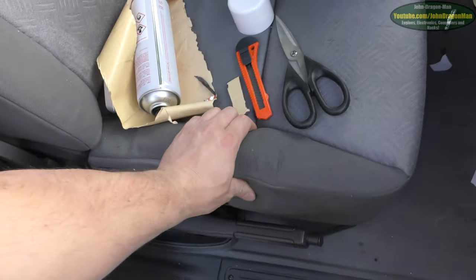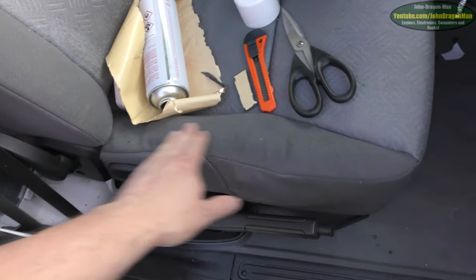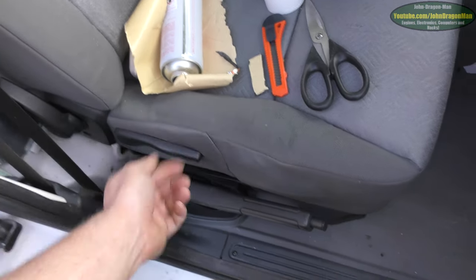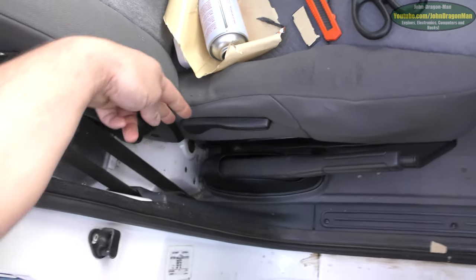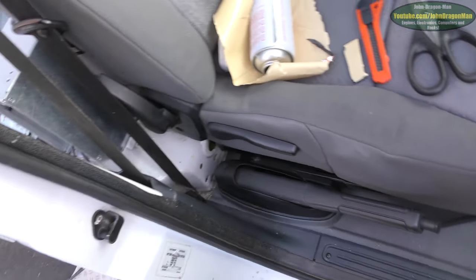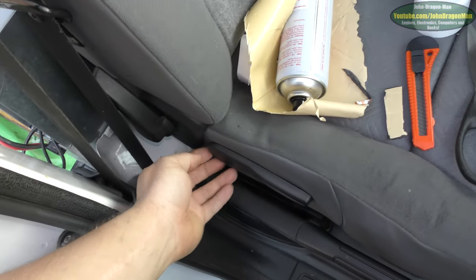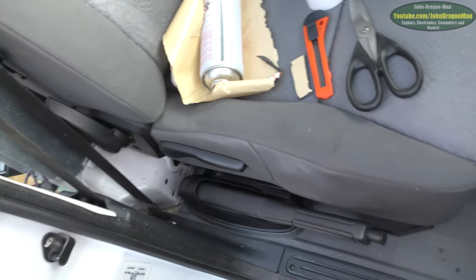I also tried to fix the seats. All of these seats get a little flat spot here where you sit on it to get in the van, and I've just banged a bit of foam in there. Thankfully, this part of the seat just unclips from the bottom here. If you've got a fork-shaped device — I think I used a pair of thin needle-nose mole grips — stick it behind there and it just pops off without breaking anything, which is nice.